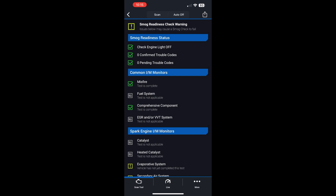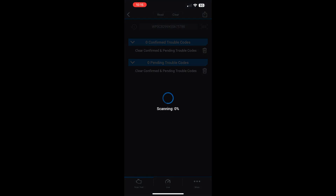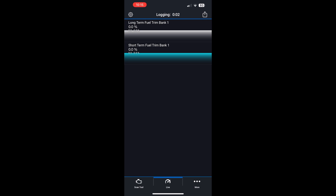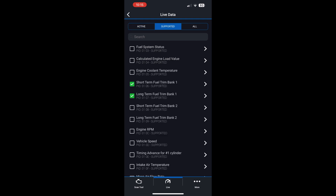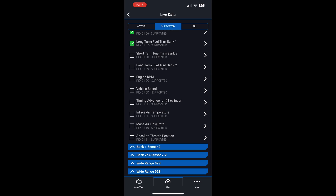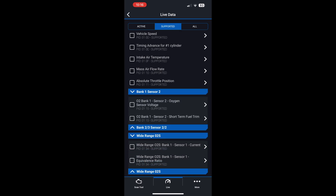These features are very important to me since I own three old cars, each of which needs to be inspected for emissions. I don't have to drag around a laptop or a large diagnostics tablet — I can just plug this in and get it done. One key enhanced feature I use quite a bit is live data. If I'm measuring fuel trim or need to know my throttle position, I can record this data while driving and review it later at my desk.